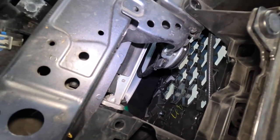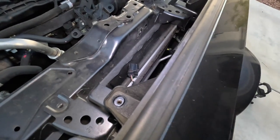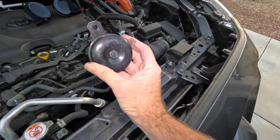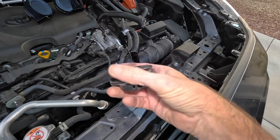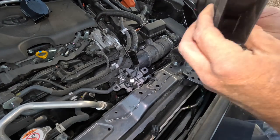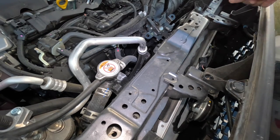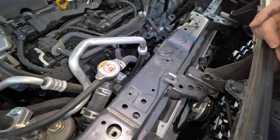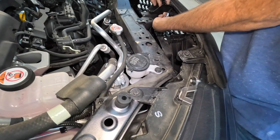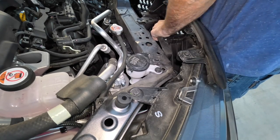So we have the other horn right there and there's the harness. Here's the horn — it mounted that way. I think there's no real speaker on this thing; it just comes out in every direction. I would assume the horn would be going down. Just in case we want to put these back on: we had red on the right hand side and white on the left hand side. The only way I can get into this one on the right hand side is by using this wrench, so this one's going to take a little longer.